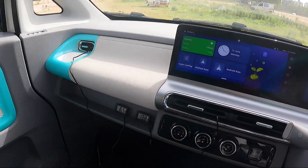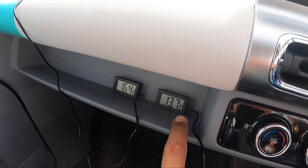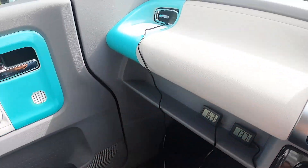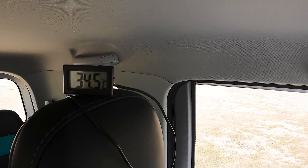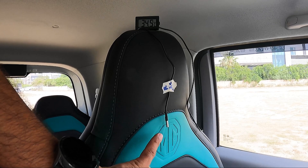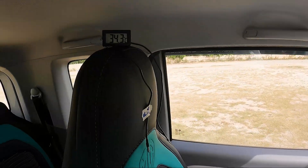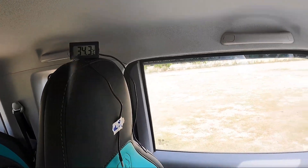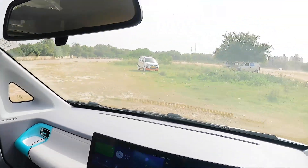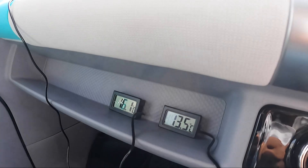Four minutes into the AC test — look at this. I think for a small EV, superb. The main AC vent is now under 14 degrees. The side AC vent is 16.3. After four minutes the display is showing — it's dropping under 35, must have been around 60 degrees before. So this sensor is now getting air from the middle and side AC vent at around 34 degrees. At a standstill with large windows and the sun coming down hard, these figures are super good.